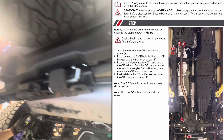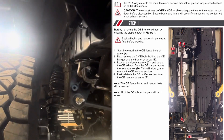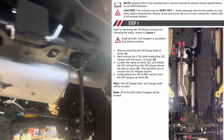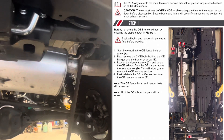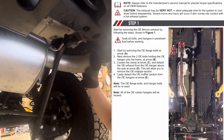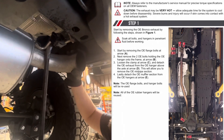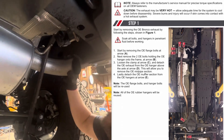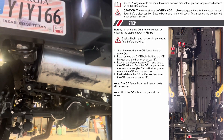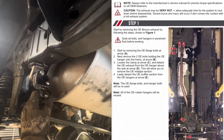You are going to reuse everything you're taking off — those four bolts and the rubber hanger mounts are all being reused for the entire system, so make sure you're not throwing those away. A crowbar is a really simple way to help pull those rubber mounts off, which makes things a lot easier. Once those are removed, you'll be able to remove the entire OE system and move on to the next step.